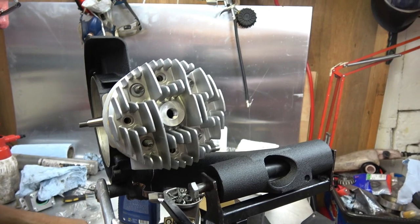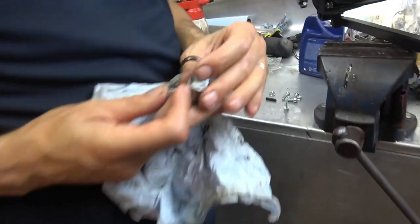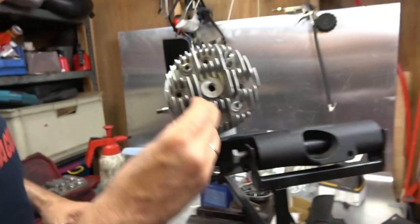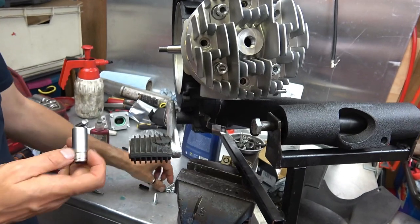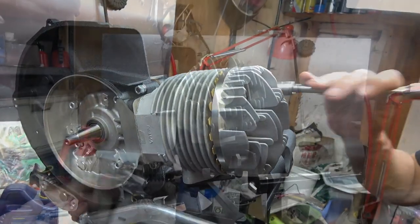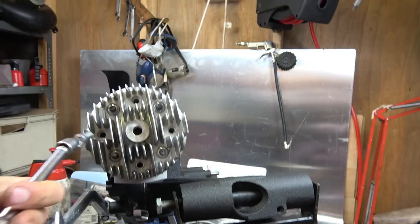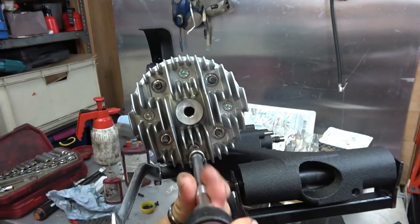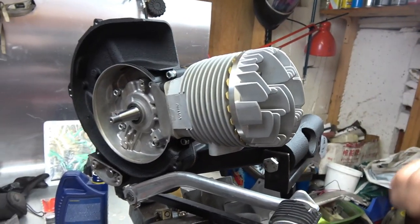Four plain nuts, four washers — so it must be plain nuts and washers. Top tip for this: if you get a piece of paper and stick the nut down the side of it, you can just use it to screw onto the stud easily, because it stops the nut sinking too far into the socket. A little bit of Loctite on these because they've got no washers. They're not going to come loose anyway. That's tight — 18 foot-pounds on all of those.